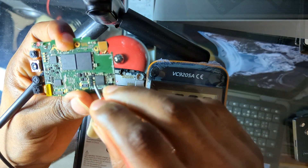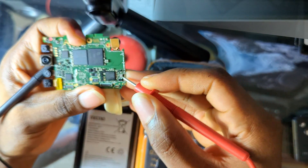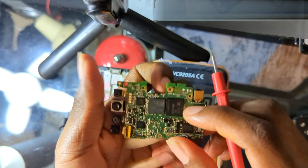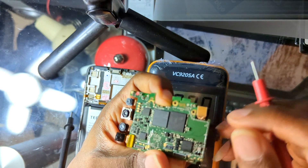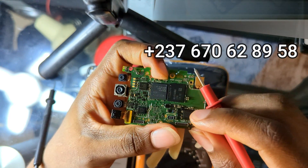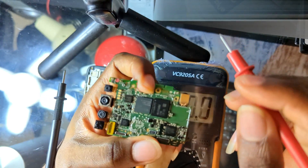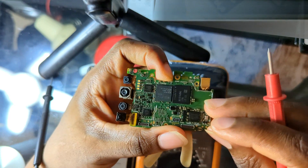The RTC for this phone is a crystal oscillator tied to the power IC. If you have all the correct voltages — including the power-on input voltage — but the phone still won't switch on, replace the RTC with the correct part number. If you want to learn all of this in detail in a short time, you can send me a message on WhatsApp to register for my mobile repairing course. Otherwise, subscribe and watch more videos. Thank you and see you soon.